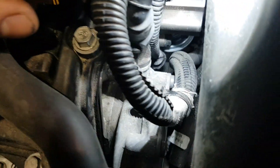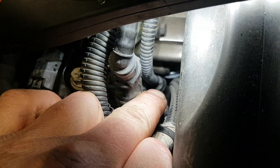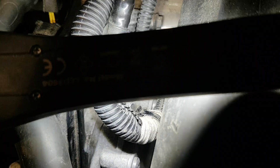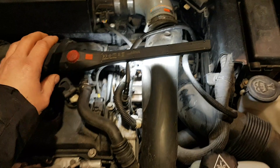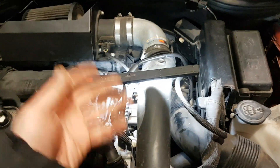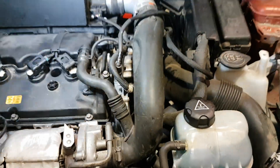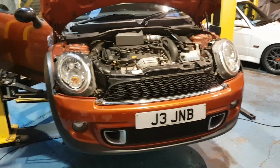Don't be concerned — you can run it up. I've bled the car out. I put a new water pump in there; there's the reservoir bottle, and you can see a little pipe coming off all the way up here. There's a little flat edge down there and that's what you feed your screwdriver in and twist that a few times. That allows air out and allows water in. Once water comes out of this bleed nipple the engine should be bled. I hope that helps!